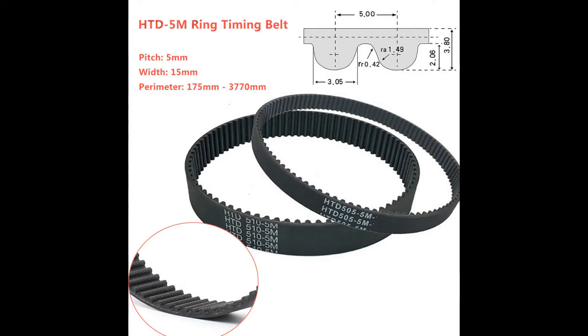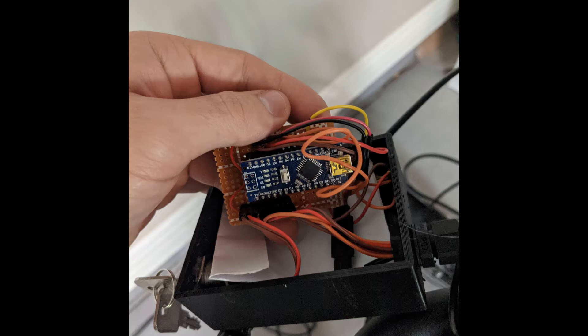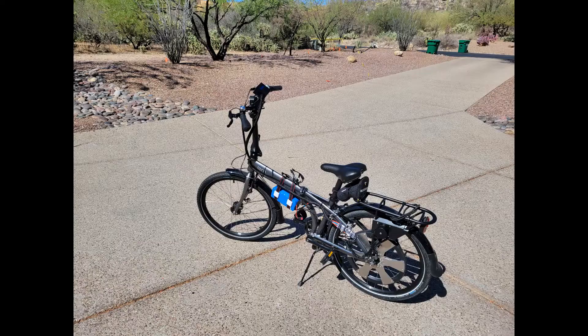Initially I tried to splice a belt myself using pins; however, the splice was far too weak to handle the motor's torque and broke instantly. It was replaced with a pre-made 1,175mm circumference HTD-5 belt from China, which worked fine. The bike's brain is an Arduino Mini running code I wrote that gets data from the VESC, controls the dash display, and interprets throttle signals from the Hall Effect throttle on the handlebars, sending them as a PPM signal to the VESC. The Arduino is housed in a 3D-printed dashboard mounted to the handlebars, along with an LCD display, circuit board, and key switch — the bike will not interpret throttle signals without the key being turned on. The wiring was cleaned up with wire wrap, the battery was mounted using nylon straps and 3D-printed guides, and the bike was finished after some mechanical tweaks and software alterations.